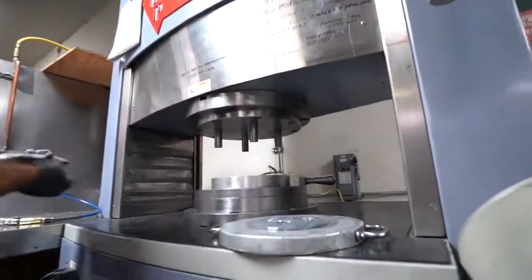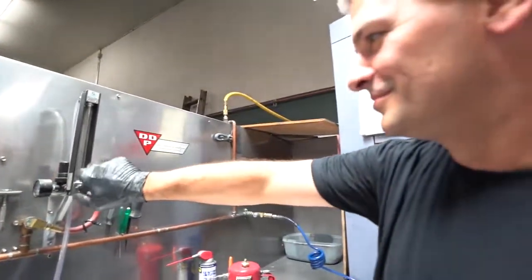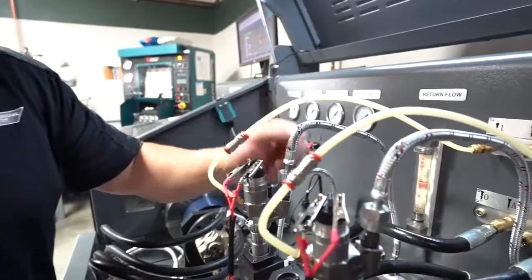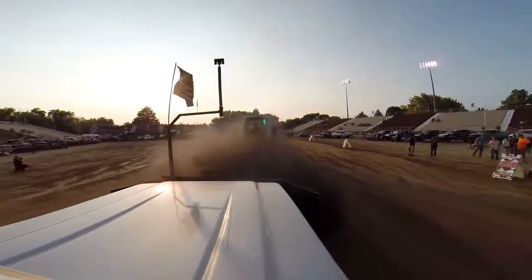As you make an injector bigger, the balance rates get even further apart, so as you go up in size it takes a lot more precision. We actually have some custom stands that nobody else has — we work with tooling that isn't just your standard Bosch stuff. It's all hand built; the owner still hand builds all the big stuff for all the big competitions, whether you're towing or competing in the UCC.